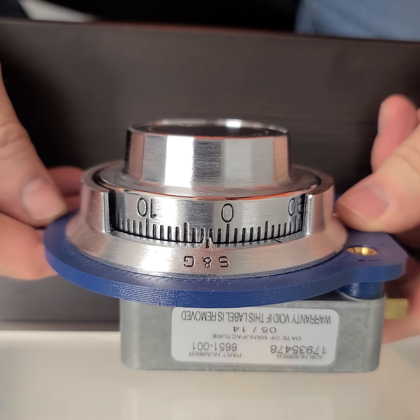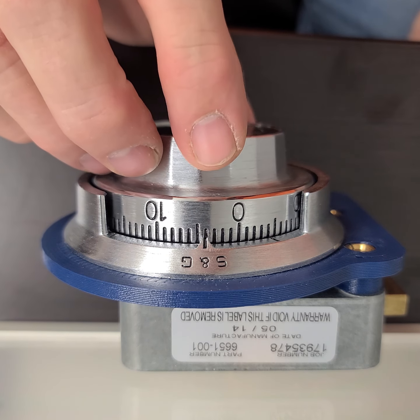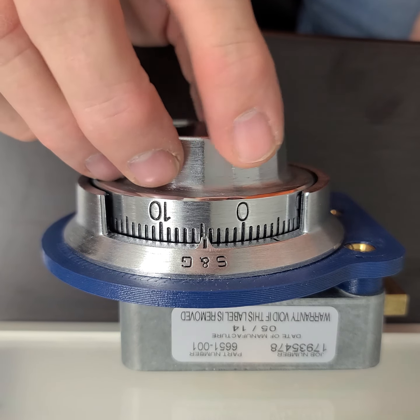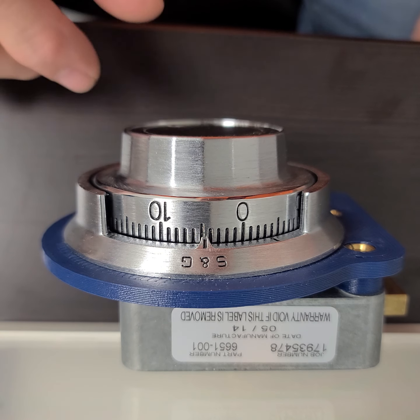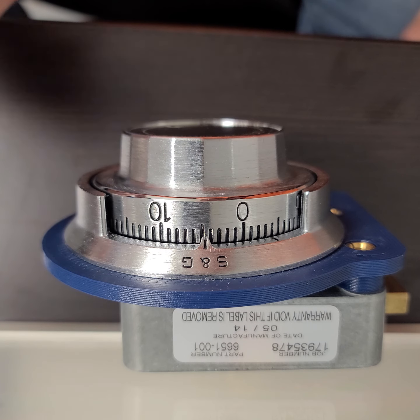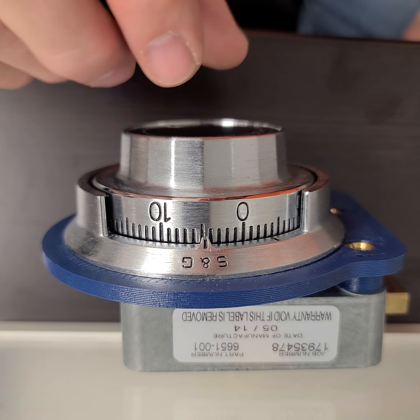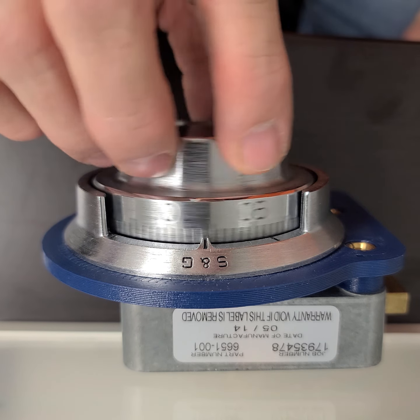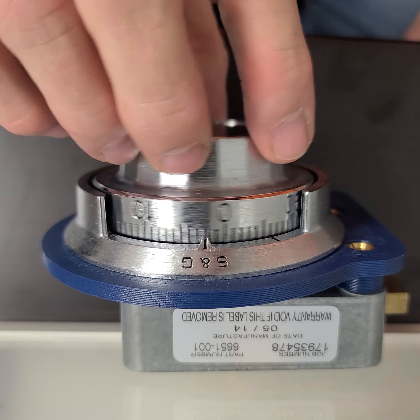What I do when I'm manipulating one is I will run over the contact point a time or two — either the right or the left, depending on which one seems to be moving the most — and I will look to find my highest reading. Right there we're at about four point seven five, lower four six and a half, right at four.